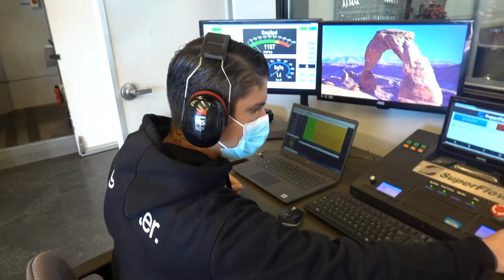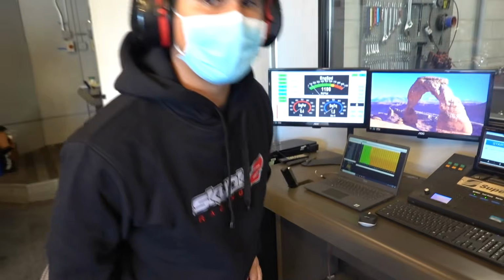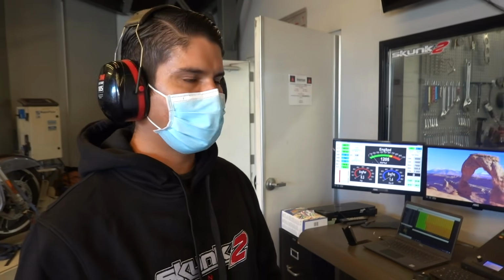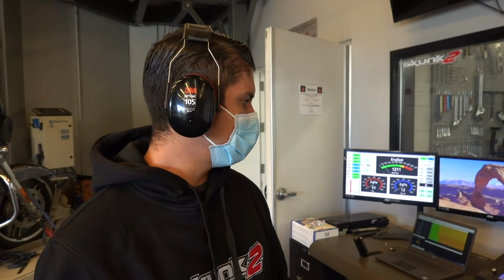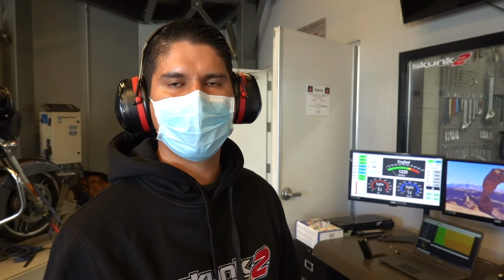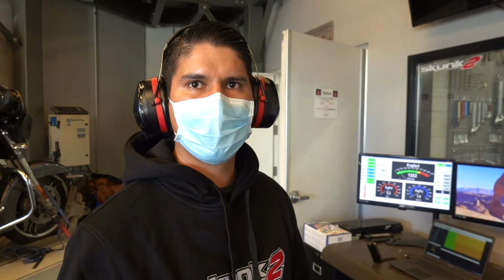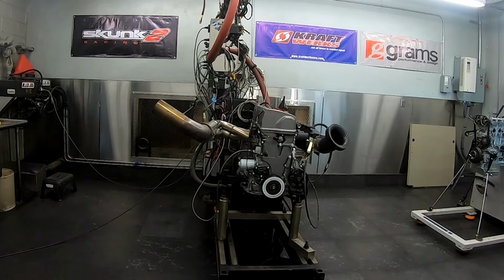You want to introduce yourself, explain what's going on? Well, my name is Daniel. I do the tuning here. So pretty much what we're going to do first is just get up to temp. We're going to break in the engine, so we're going to hold it roughly at 3,000 RPM for maybe 5-10 minutes, make sure everything's good. And after that, we're going to start making some pulls, then we'll see what happens. All right, cool.